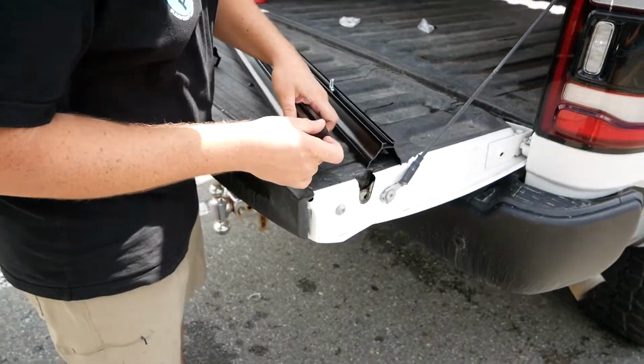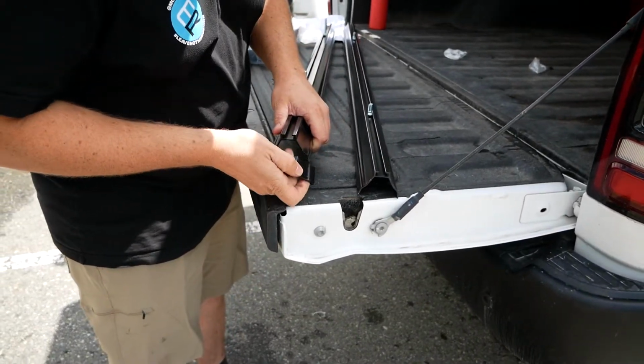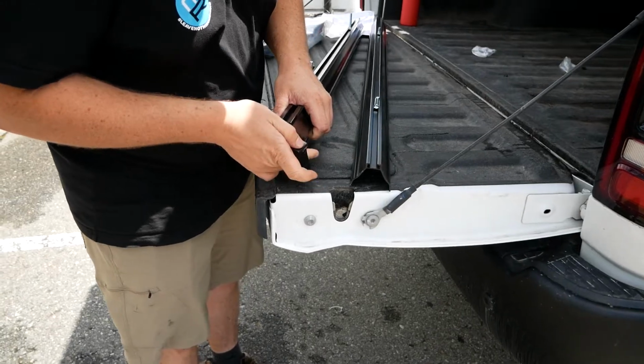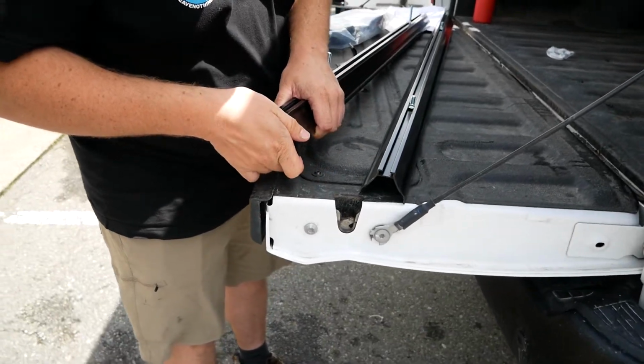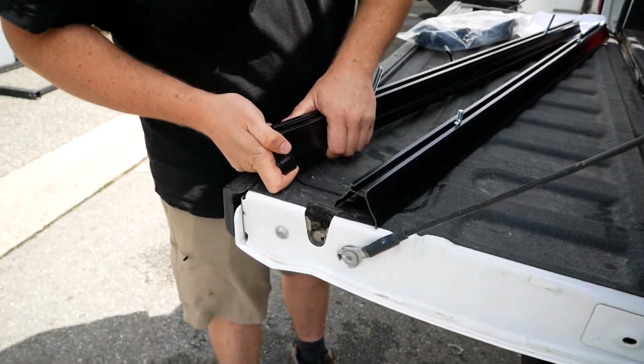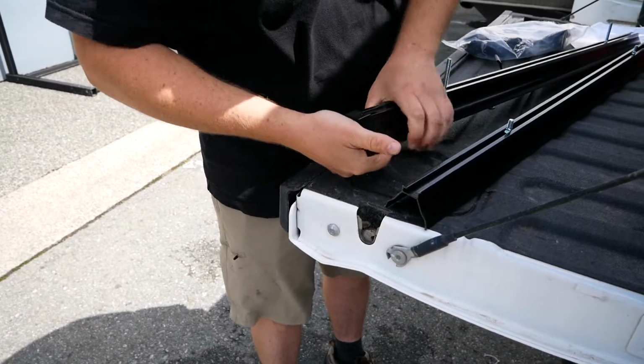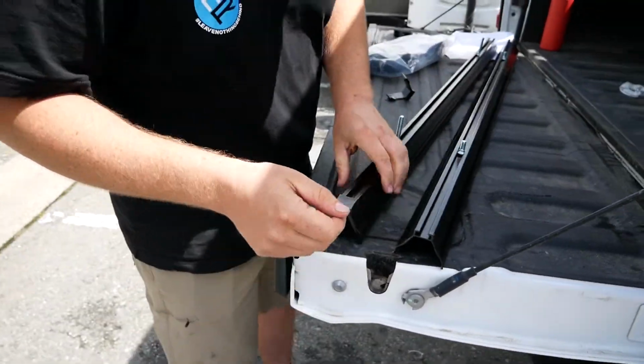So pressing the end caps onto the lower bicycle trays is a bit of a tricky maneuver. I found the easiest was to put the top of the end cap on first, then sort of get the lower one in orientation, and then stand the whole thing up on end and basically push down into the ground, or down into a table or a bench.